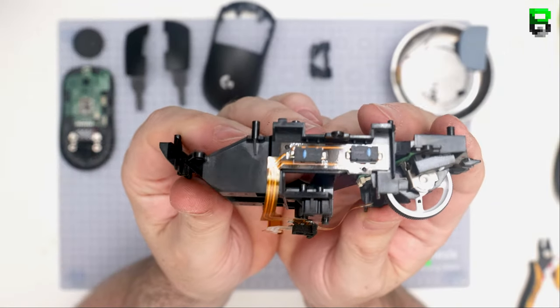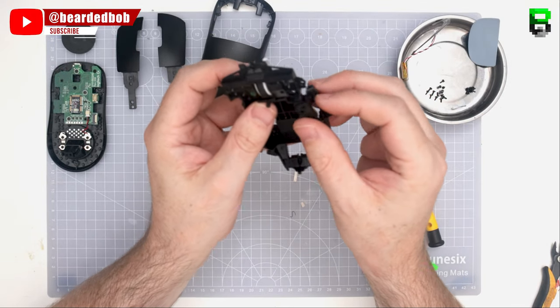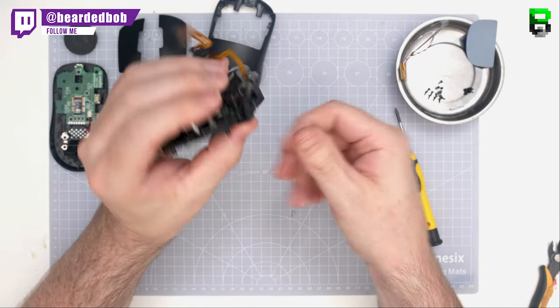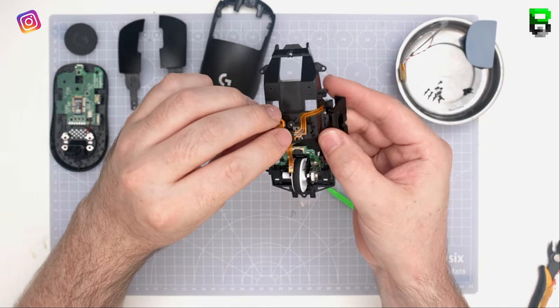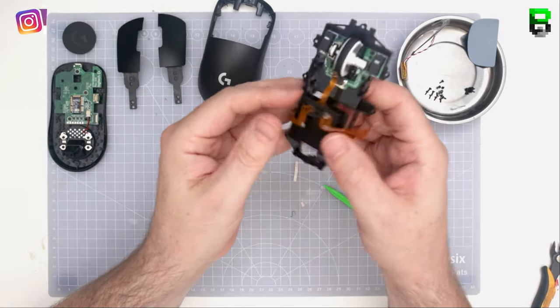That's the tape on now. It looks stock, you can't even tell. Put the side buttons on, this puppy is going to feel sweet. Again, you can use the screws to alter the actuation or the pre-travel. What you've got to be careful of is not getting the switch too close to the plunger, which basically deadens the switch. And you'll tell that there's no spring back.